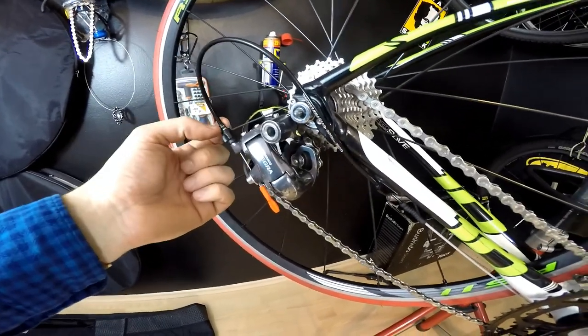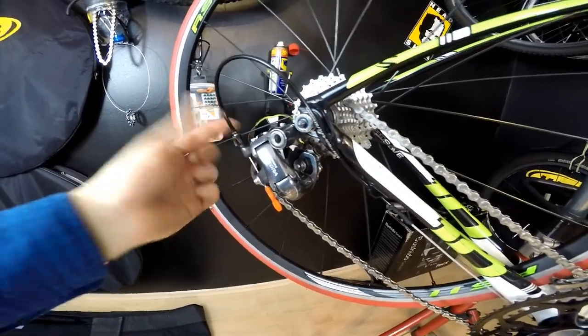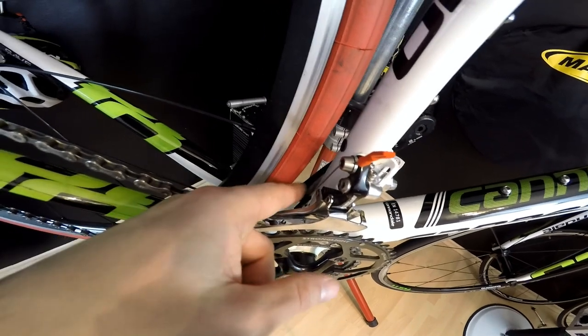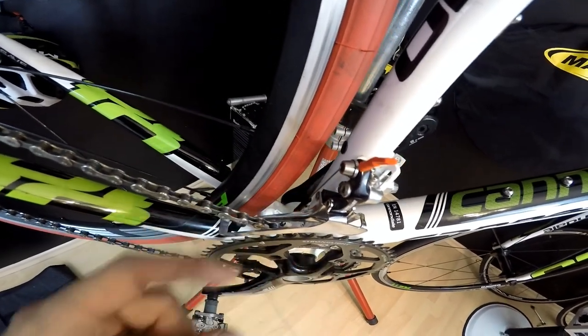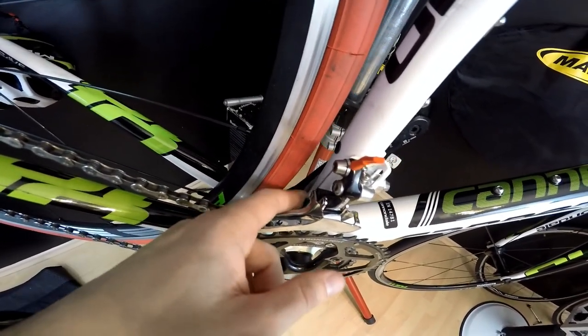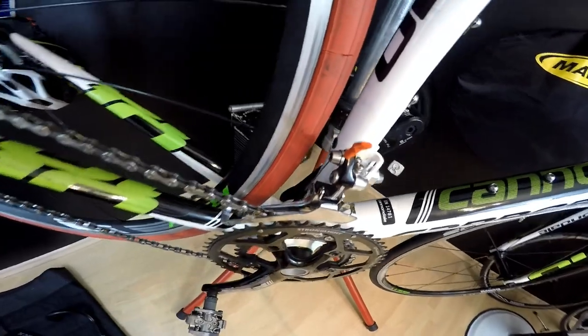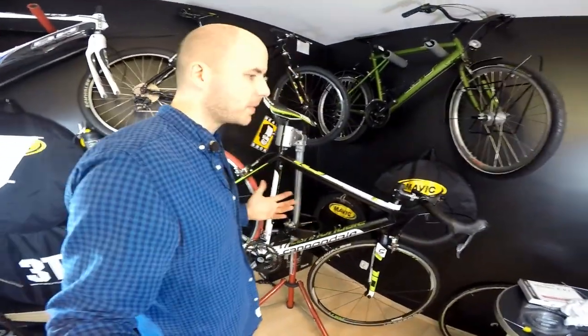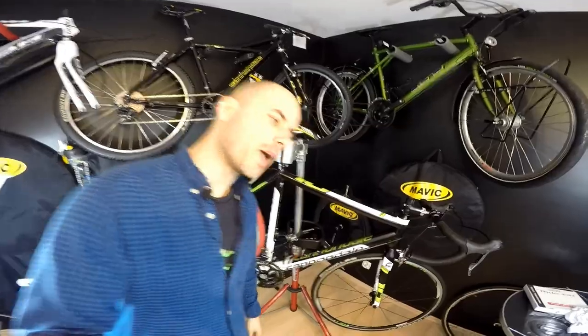The last part of the housing is not fully sealed because the ferrule there is just a standard ferrule with no rubber seal. Also, when you fit the grab seal on the front derailleur cable, make sure it won't rub against the front derailleur. Otherwise it's just great — a real improvement for my bike. Thanks for watching and I'll see you soon, bye bye.